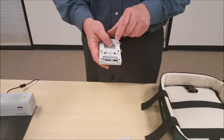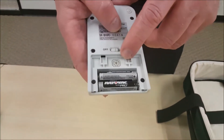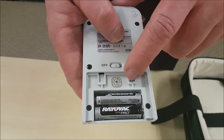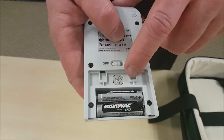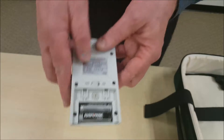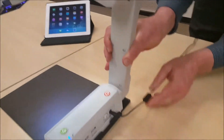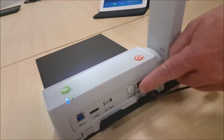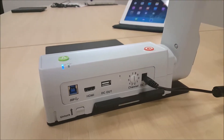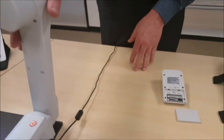The last thing that's very important that I want to show you inside the remote control is our channel selector. On the back of the E-Bot unit and the remote control, you need to make sure that it is set on the same channel. On this one, it's set on zero. And on the back of the E-Bot unit itself, we have our channel selector right here, and there's an arrow on that button in the middle indicating it's on zero too. So that tells me that the remote control is programmed to work on this E-Bot.